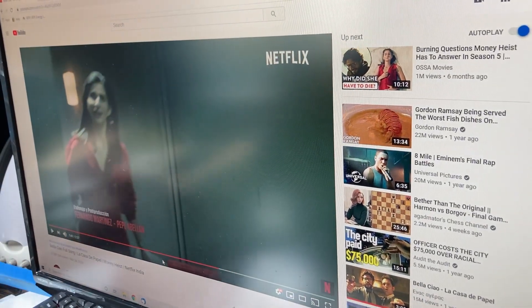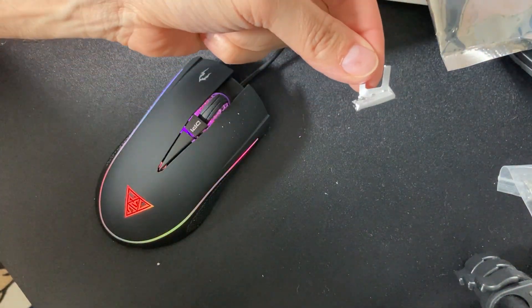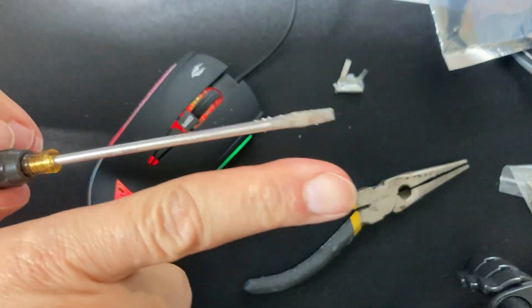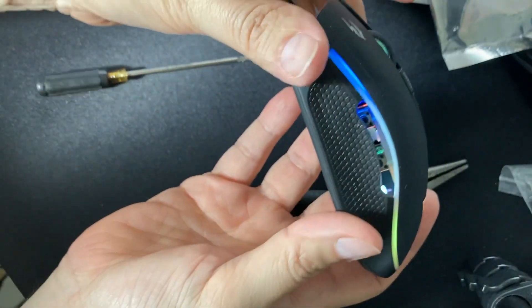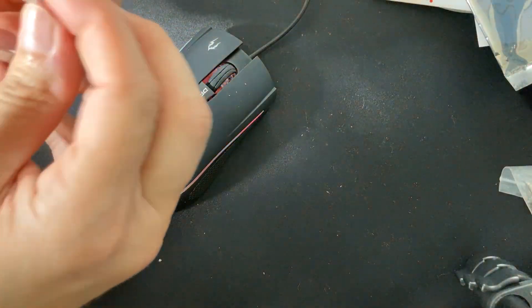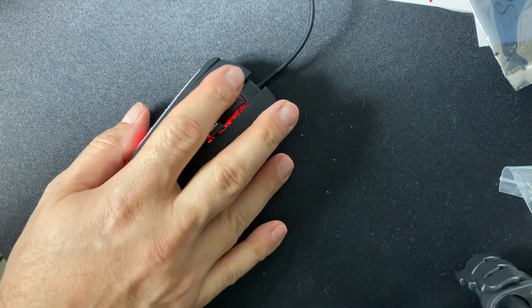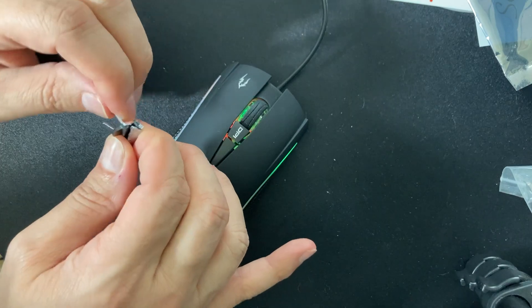It looks like it works. The solution is simple — remove this with a relatively small screwdriver. This was a dumb mouse to begin with, meaning it was non-programmable. All I did was remove the buttons. They weren't glued in or anything — just in there with some springs, nothing moving around inside, which is great. She functions perfectly. I'll never have to worry about my thumb hitting those side mouse buttons and paging forward or backwards again.